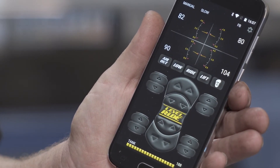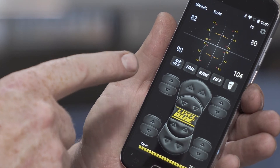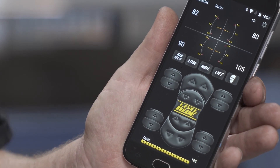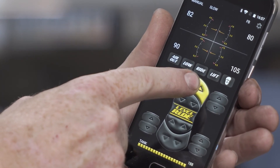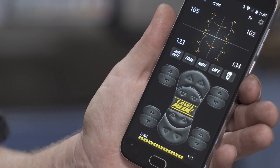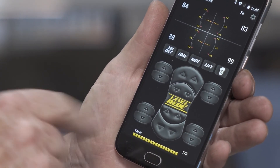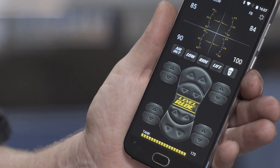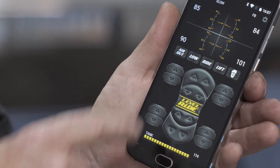We're currently in sleep mode. In sleep mode you can save heights, but it won't show on the screen that you're at that saved position because in sleep mode you're always in manual mode, not automatic mode. If the vehicle were running, it would stay illuminated. We'll raise the vehicle up, press and hold lift — we've now saved lift. When you start the vehicle with ride-on-start set up, it'll come to ride height and illuminate ride in yellow confirming you're there.